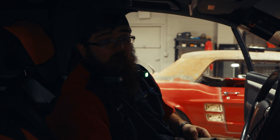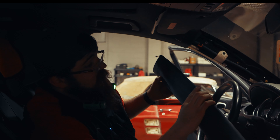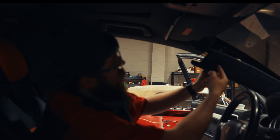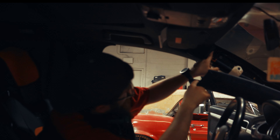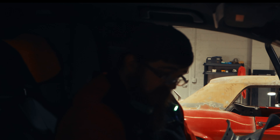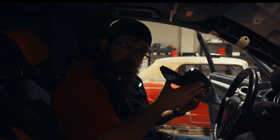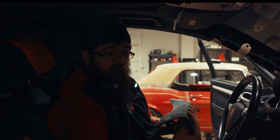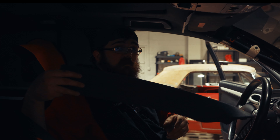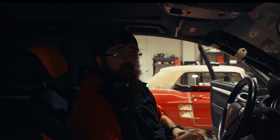This shouldn't be in the car looking like that. Let's make it right. Also, putting this back up here — it doesn't clip right, so don't do a screw. There's an airbag right there. And you also punctured some wires going through this harness. Practice your standards — get the clip, replace the clip, put it back in. It's like new. That way we don't have a screw going through an airbag or main harnesses that are vital to the car.